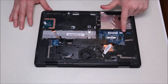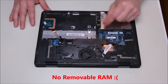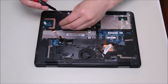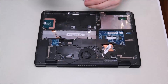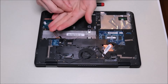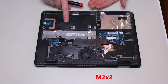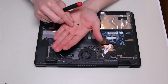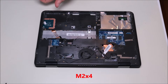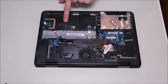For those of you looking for RAM — the RAM is integrated into the motherboard on this computer, so you cannot easily remove or add RAM. Regarding the screws: the wide, flat, silver ones are referred to as M2x2 screws, and the normal-looking black ones that are a little longer are the M2x4 screws. That helps you know which screws go in which holes when reassembling.